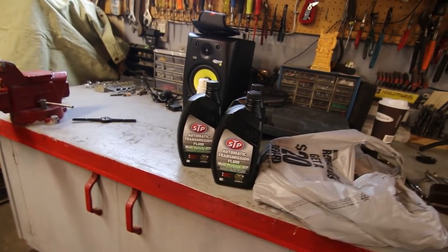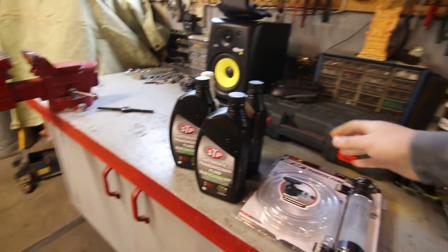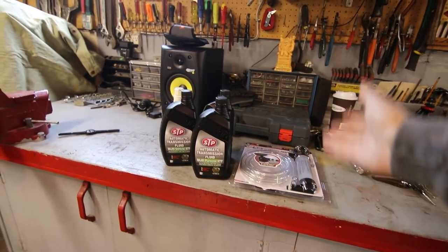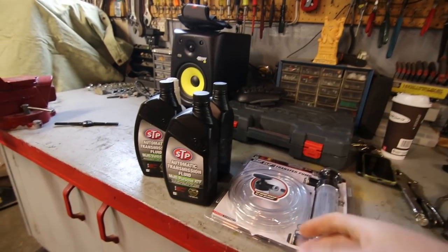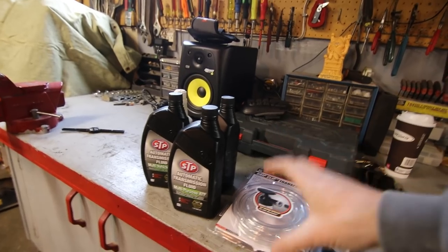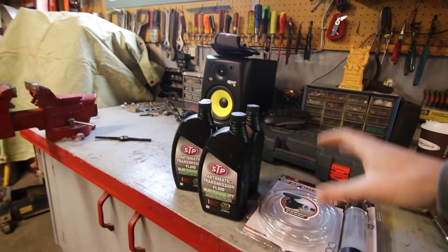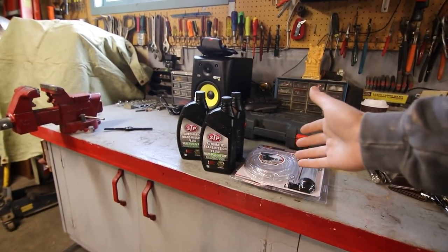It's not actually 5W30 or like a 90 weight. Some cars that are earlier actually use gear oil like you would put inside of a differential. Some also use 5W30 motor oil in the transmission, believe it or not. I believe if you go back to a T10 that would have come in an 82 to 84 Camaro, if it were the manual transmission, you would have had a 4-speed. If I'm not mistaken, they use gear oil.